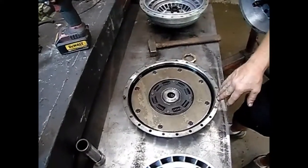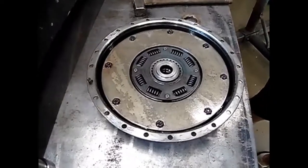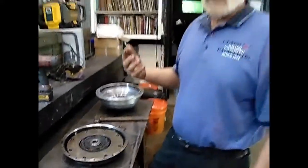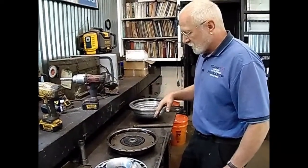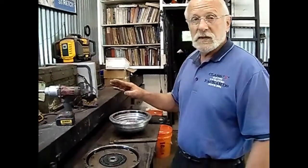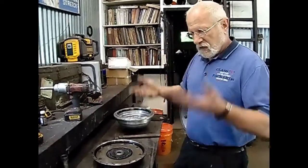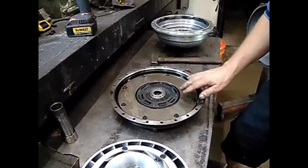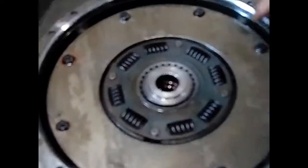In the bottom half of the housing here is what's known as the direct drive clutch. Because Packard's torque converter had such a high torque multiplication, it means also that at cruising speeds it would slip a lot — and nobody wants that. Buick had that problem and it drove people crazy with all the slipping. So Packard introduced with their automatic transmission a direct drive clutch packaged behind all the torque converter elements, so that when you came up to cruising speed, the governor inside the transmission would signal the piston to rise up and capture the clutch disc, giving you a very efficient drive. We're going to look at this clutch disc now — it's right behind this plate.